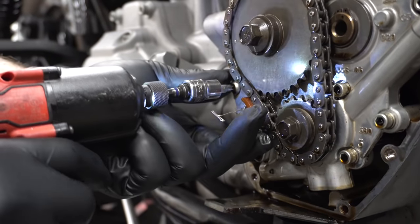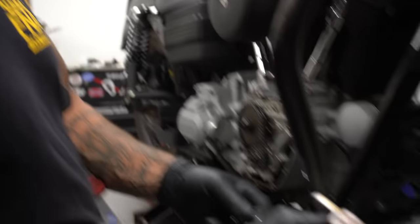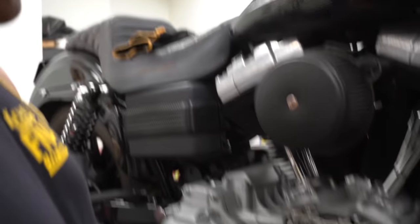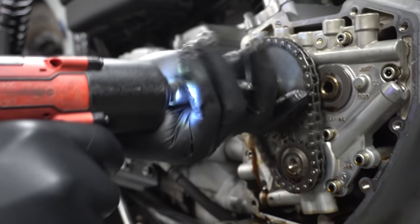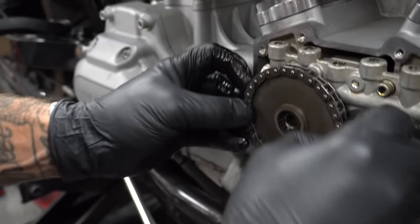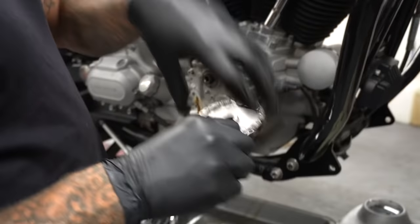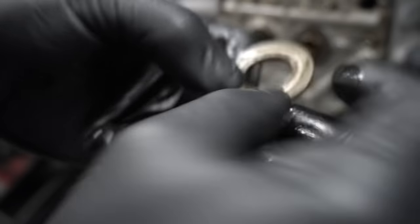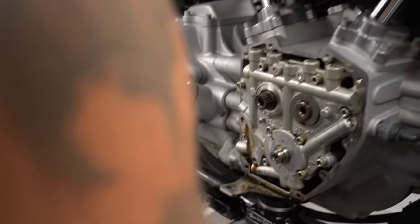We are putting new Fueling tensioners in this — just a good habit, keep your shit nice. That tensioner is toast too — 40,000 miles is pretty good. If this was an early model spring loaded cam chain tensioner, it would be all the way through the aluminum by now. Zip that off there — cam gear. They're going to come off evenly. The chain needs to go back on the same direction; you can't flip it around because everything sets in the teeth. This is your cam sprocket spacer — it has measurements on it. We got a 110 in here, which we'll have to shim accordingly when we change the cam out.